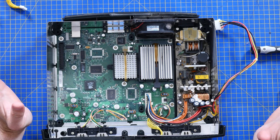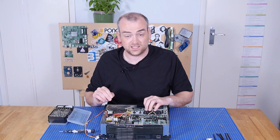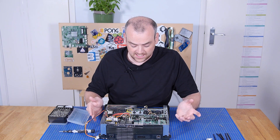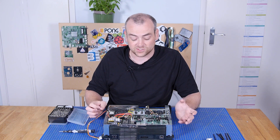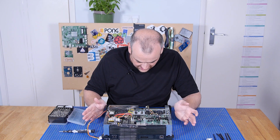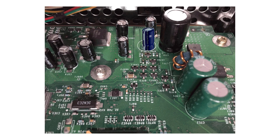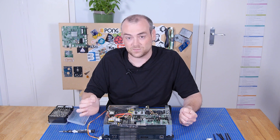There's a little bit of dust in here, nothing too bad. What I'm really interested in is the capacitors, because apparently from the late 90s through to about 2010, there was an industry issue with capacitor quality. It was a time when big name brand capacitors that had been around for generations started to lose out to cheaper mass manufacturing and the quality plummeted. The Xbox in particular suffered because they decided to replace the little CR2032-type 3.3 volt system battery running their system clock with a supercapacitor — and unfortunately, that supercapacitor is well known for dying and killing the board.